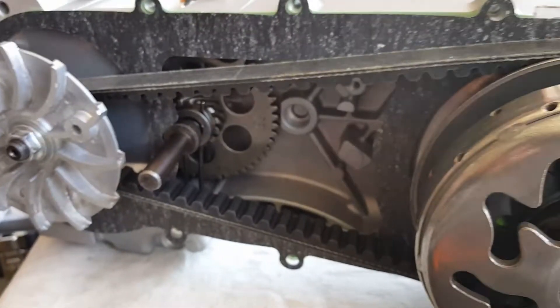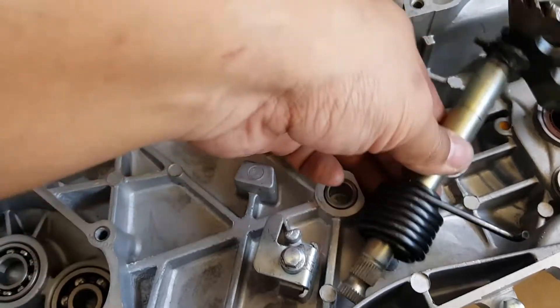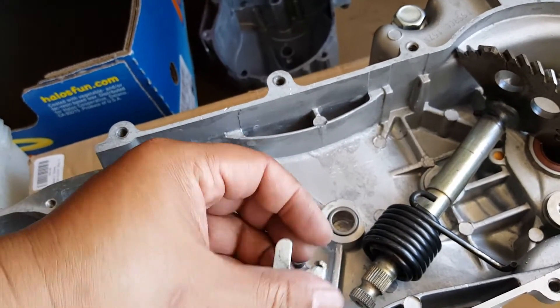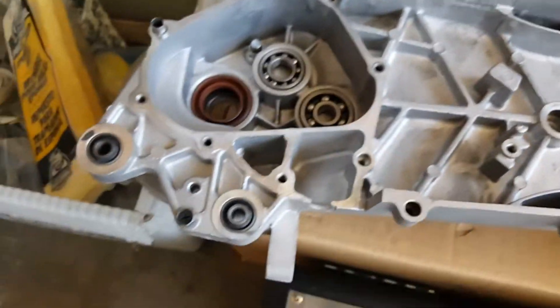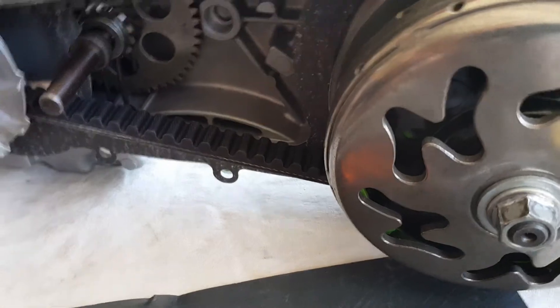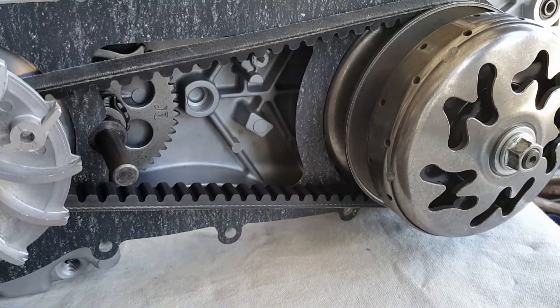Now we can focus on our gear sets. Our next gear is the actual kickstart gear. We're also going to need this part here — it holds the kickstart shaft spring. Take the bushing out; you can use your pinky finger to dig it out. Those are all the parts we need. Unfortunately we couldn't get the dowel pins but we'll get new ones later.